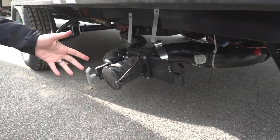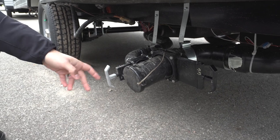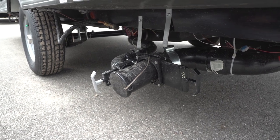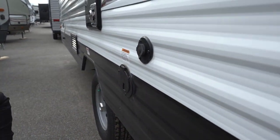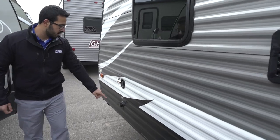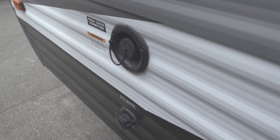Right down here is your termination. This unit does have a black and gray tank, so when you're ready to dump, pull your black valve first to get all your solids out from your toilet, then pull the gray valve to kind of wash things out. It's nicely centrally located with just one termination — pretty simple to dump. Right up above that is your 30-amp power cord stored inside the camper, and you also have your cable inlet right there. Up front are your two water connections: city water hooks up here, and if you're boondocking and want to fill your fresh water tank, you put that right in there. That wraps it up — this is the 2018 Coleman 16 FB. If you're interested and want price and availability, simply click the link in the description below. Thanks for watching, I'm Ian Baker, and let's go camping!